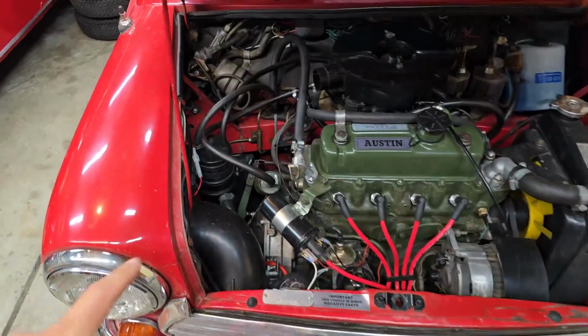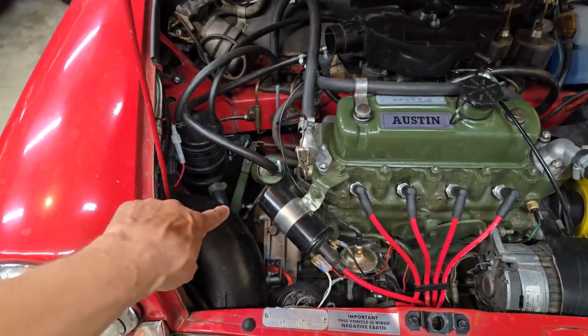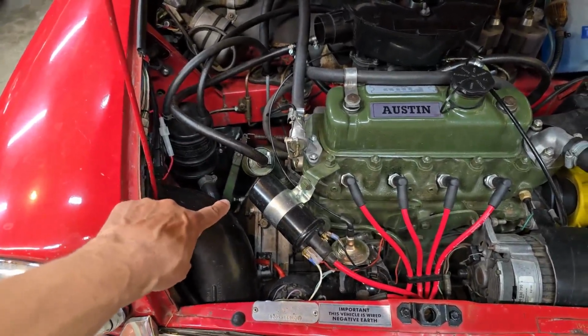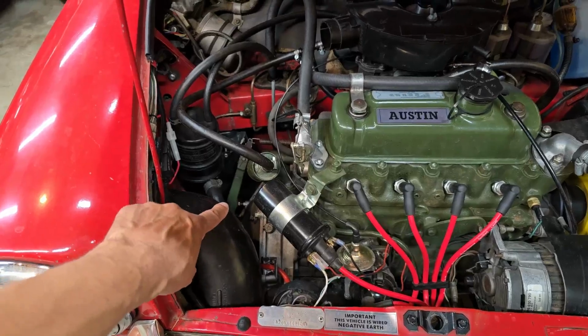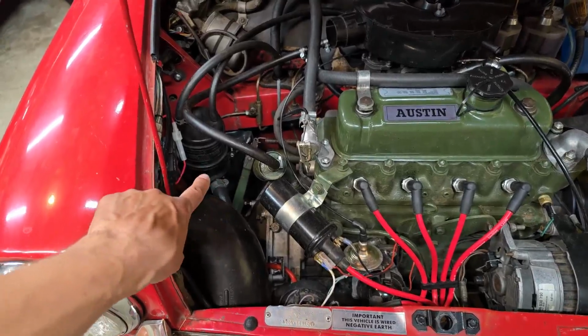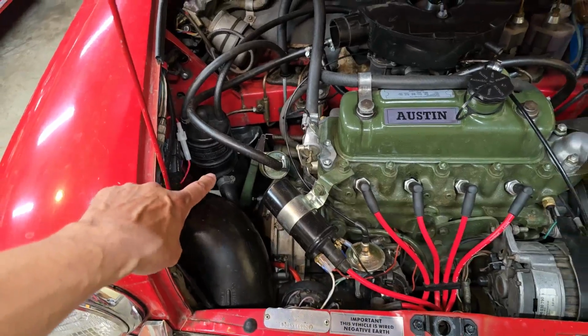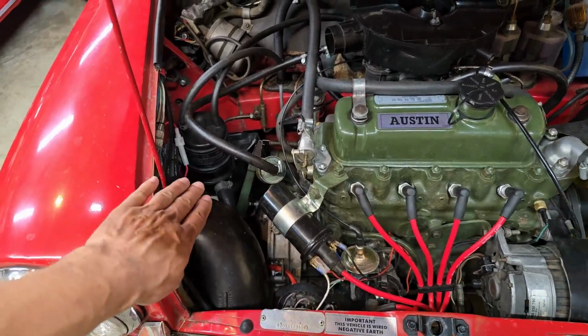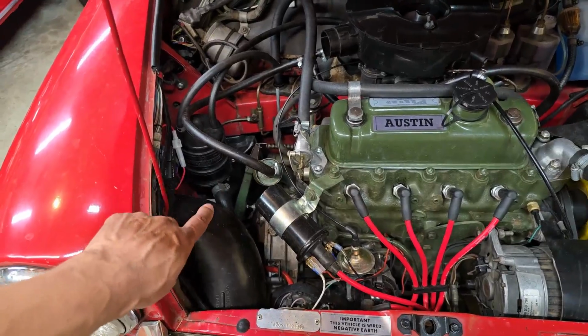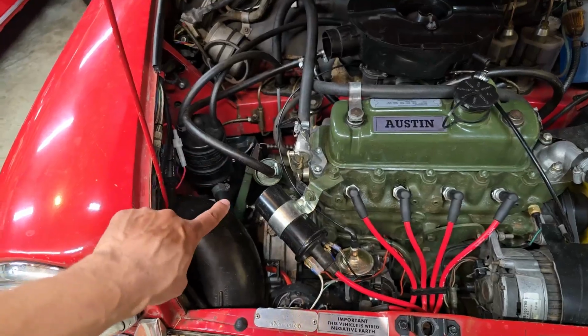Before I go any further, I just want to mention that yes, my hydraulics are working properly. The clutch is properly adjusted. There's only a small gap between the throw-out stopper and the arm itself when you pull the lever out. And I've adjusted those nuts down there a few more flats out, so I'm not having a disengagement problem. It has nothing to do with hydraulics or this part of the mechanical linkage itself.